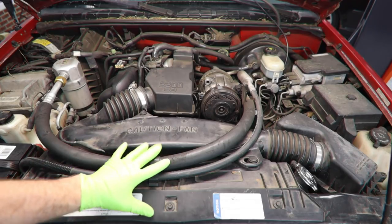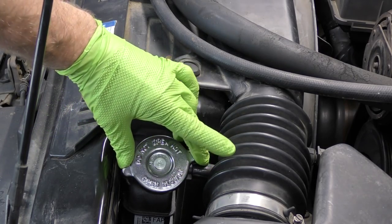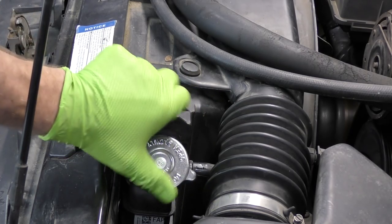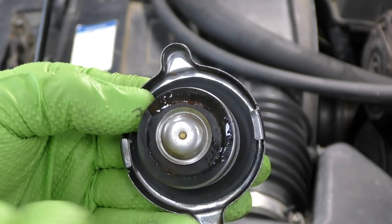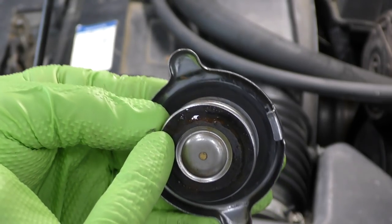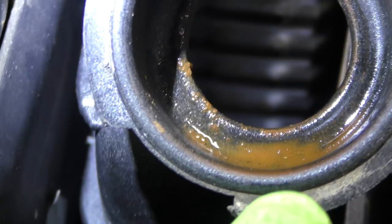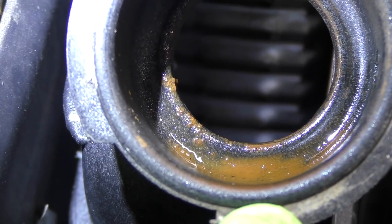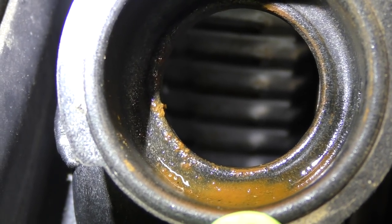I want to start with a couple of basic checks. We know the radiator was replaced, so let's take a look at the coolant. Something else that can happen when head gaskets leak is oil and coolant can mix together, either in the cooling system or in the crankcase. So we're going to check the coolant and we're going to check the engine oil. Now, if your engine's up to temp, don't take the radiator cap off — you will have a very bad, dangerous time. I don't know if they replaced the radiator cap along with the radiator, but if you see on this rubber seal here on the cap, there's some grunge on the seal. Probably clue number one that we have a problem. When we look into the radiator, the very first thing I'm noticing is the level is very low. I'm also noticing that the coolant is kind of brownish, and it looks like there's some deposits inside the radiator. When the radiator was replaced, they filled it with new green coolant. So yeah, this coolant looks pretty sad.